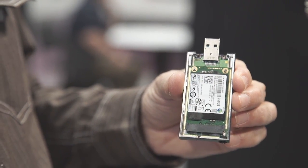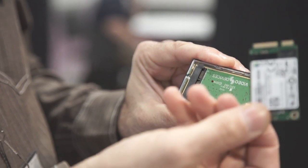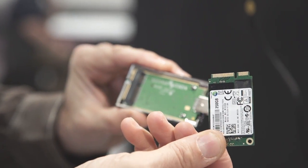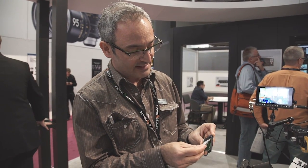Let me show you what's inside. If I just pull one apart — this is an mSATA, an industry-standard mSATA SSD drive. These are available everywhere: Amazon, Newegg, wherever. They're very cost-effective, and they go up to one terabyte in size. To install them, it's dead easy — you just slide it in, click it down, and put the lid on.